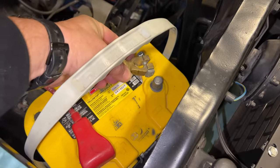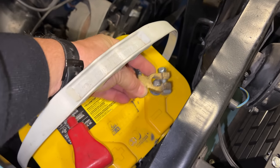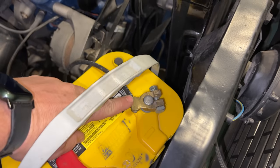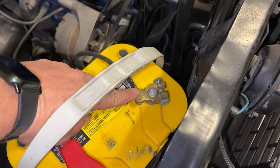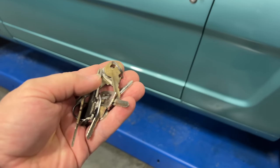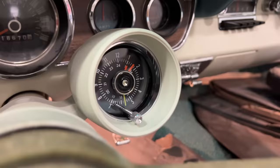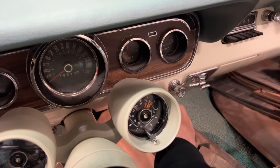Before I connect the battery I just want to tap the terminal to the battery to make sure there's no spark and no short in the wiring somewhere. Seems safe. Whenever I'm working on an unknown car, I always leave at least one terminal loose - that way if there's a problem you can pull it off quickly. I have a whole pile of keys that came with this car, so I need to see if any fit the ignition. The interior lighting works, and I can hear the clock working. I found a key that works.